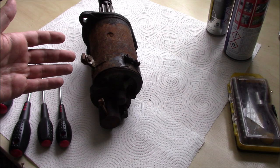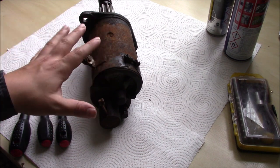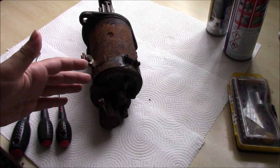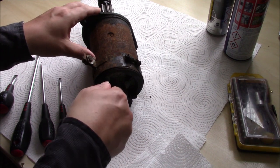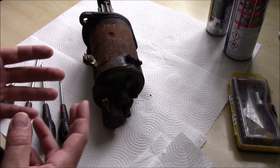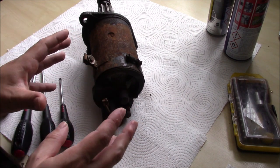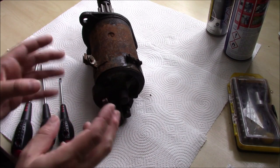It became one of those jobs. Now that we've got the starter motor off the car, we can look at taking it apart. I'm not going to fully disassemble the starter motor - I'm not going to go all the way down to bearings and taking the insides out. I've had a quick look inside, I already know that's not really necessary. The bearings are nice and smooth, mechanically it actually operates very well. The problem we're having is an electrical issue, because when you pull the lever here which activates the little switch, it's not always making a connection. Some of the most useful information has come from the Old Classic Car Forum, and on YouTube, and the Daimler and Lanchester Owners Club Forum.